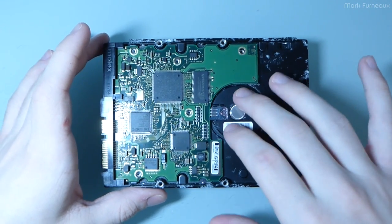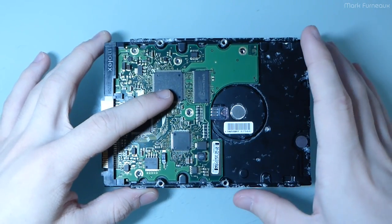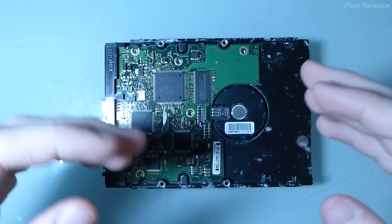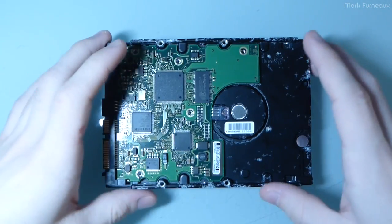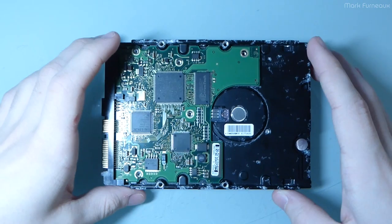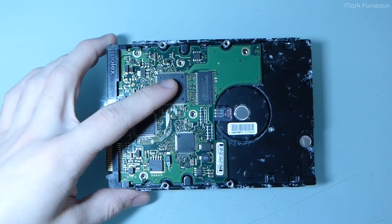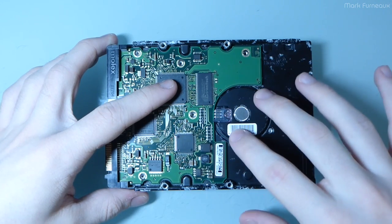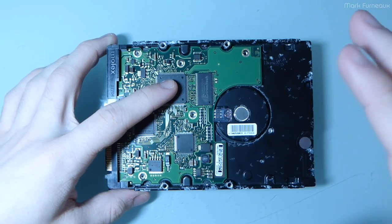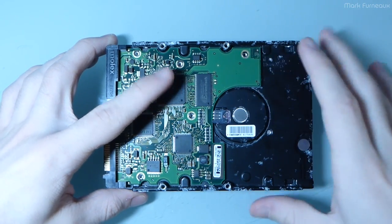So of course, in the last video, this disk was not starting up anymore. It was basically just giving the click of death. So I worked with the drive for about 5 to 10 minutes after letting it sit for a while, and I was able to sort of coerce it into starting. And it was detected by the OS, and I could see the LUKS encrypted volume on here. I entered my passphrase, and that exposed the ext4 underlying file system.